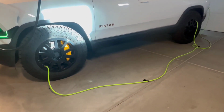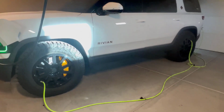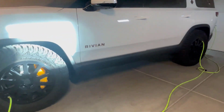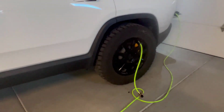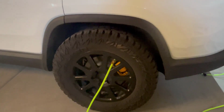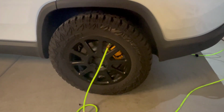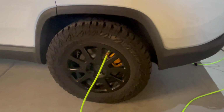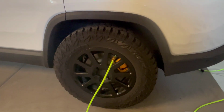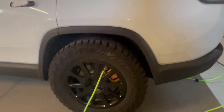So another topic I thought worth maybe discussing as it relates to this 4-tire inflation system is I think people are going to start realizing too, especially if you go to some of these non-EV, more street, off-road rated tires. These are D-load range, again 65 PSI, but I don't need all the load rating that they provide at 65 PSI, and it's just going to make you have a rougher ride and is really not good for tire wear either. There's other good videos about this.